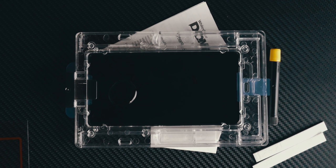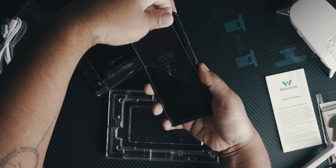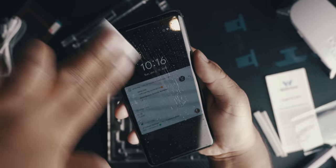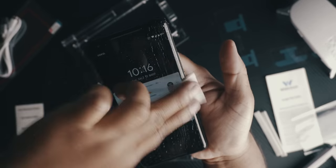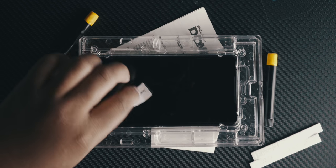Once you finish with that, you're pretty much ready to put the screen protector on. In my case, I had a tempered glass screen protector on already, so I needed to peel it off. Once I peeled that off, I used one of the alcohol wipes to wipe down the display — make sure it's spick and span clean. No dust. If it has any dust, I'd recommend using a very bright light at an angle so you can see the dust show up. Use the included dust removal stickers to lift any dust away until the screen is perfectly clean.